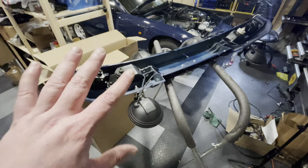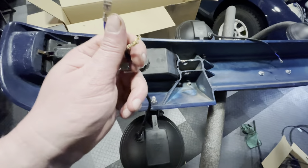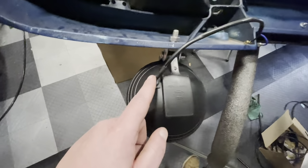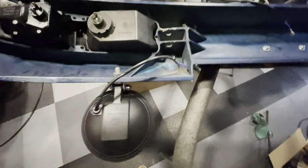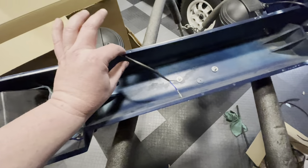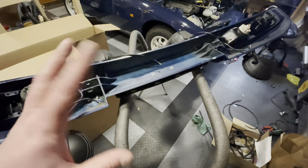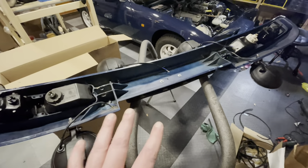The bumper is ready. I've put on slide connectors, some heat shrink, some sheathing, and again heat shrink here. This will hide that blue wire really nicely — and it just tidies up the whole look. I don't want two wires running down my bumper, so this looks nice and original. I've got four of them set up now. The alignment isn't great anymore since I had to play with the brackets a little bit — they're quite fiddly — but we've got them in now. The next step is to get this back on the car.